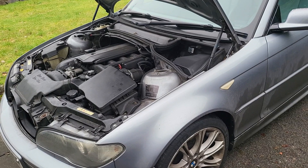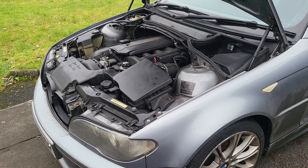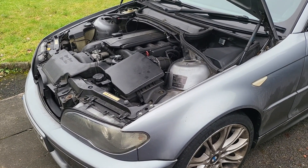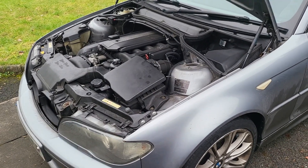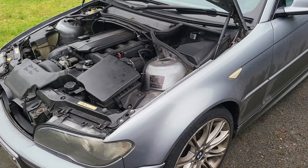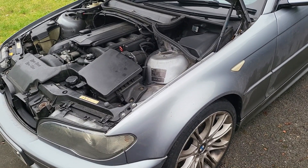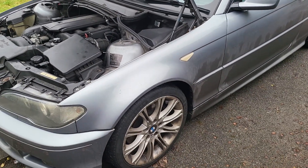The other issue I've got is my heating system. When the car is standing idle there's no heat coming from the vents — it's only when you put some revs on that you get some heat. There's probably an air pocket in the heater core. The hot coolant has to flow through the heater core to bring heat inside the car. I did bleed the system maybe two weeks ago and it did improve, so I'm going to do it again because I think there's still an air blockage.